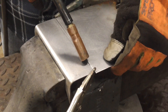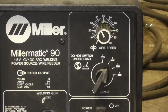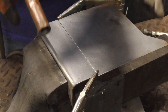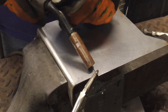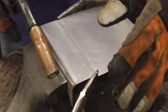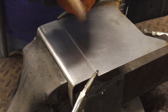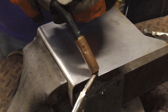Let me get the welder set up and I'll be back. Okay, so let's give this a try. The welder is set up for welding auto body sheet metal, and again I'm just going to use the lap as a guide. The camera is set so that it'll darken when the welds take place, so hopefully it helps you to see the weld better. Here we go — 45-degree angle, using the lap as a guide.